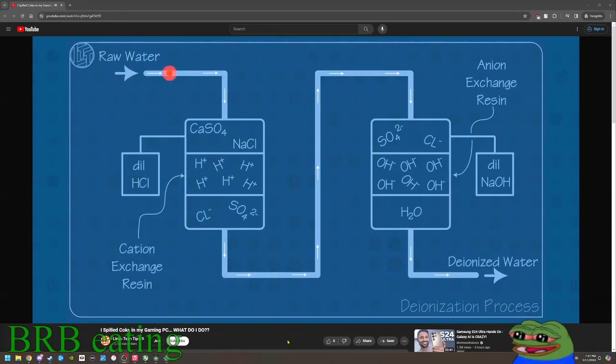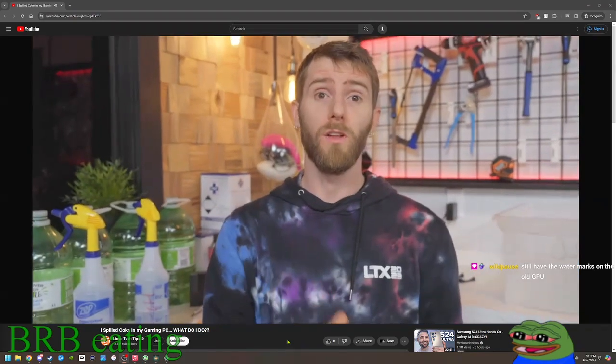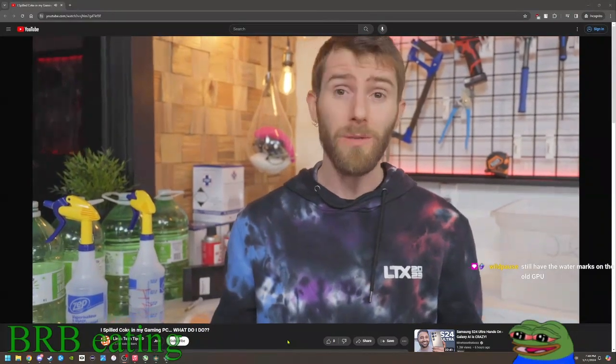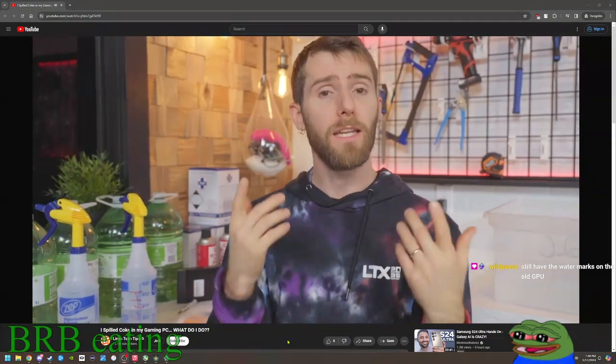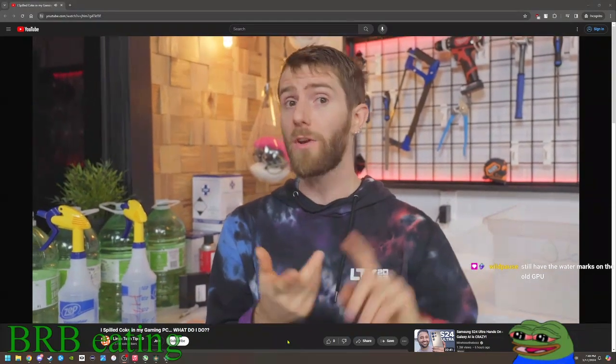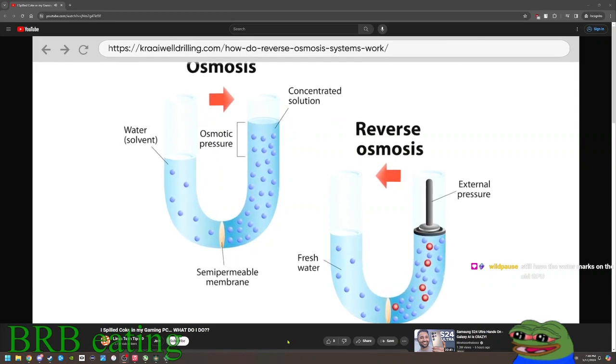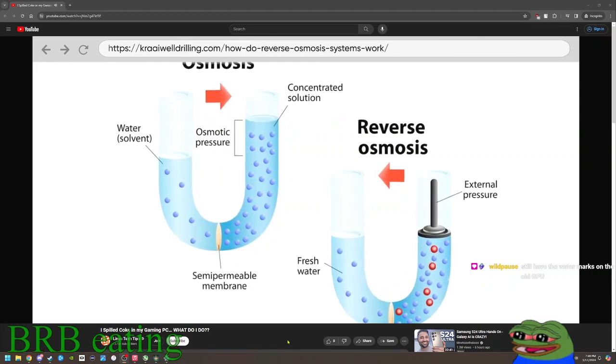Deionized water is a much better option, having passed through an ion exchange system, trading most of those random ions for additional hydrogen and hydroxide, which team up to make more of that sweet, pure H2O. The removal of those charged ions leaves deionized water unable to conduct electricity, which is another nice bonus, but it can still have organics or other uncharged impurities. If you're worried about those, a reverse osmosis process might be more suitable for your needs.